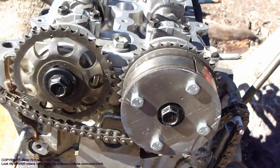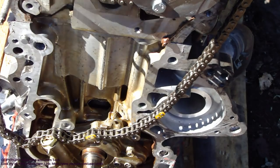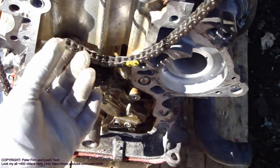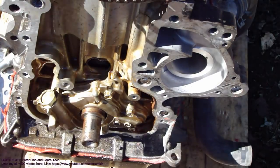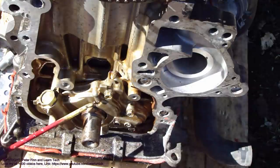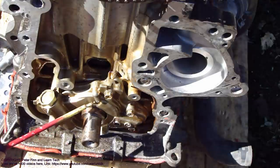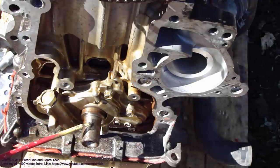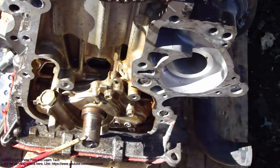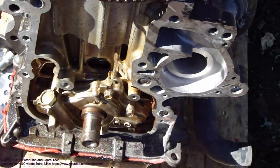Then we need to go to this lower area, and there we have this crankshaft bolt, or actually this crankshaft end, and there is also an important thing we need to check next. This is like the fourth check, and there is a small hole in here, and in that hole there is this metallic upper part, and these parts must be at the same level as they are together. If this is in a different location like in here, then those pistons are the wrong way, and we need to rotate that crankshaft. So we go to this flywheel area, and next I will show how we can move that.